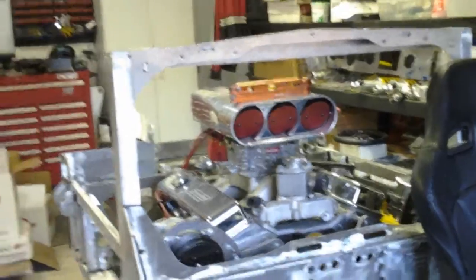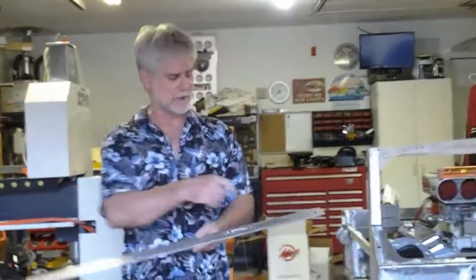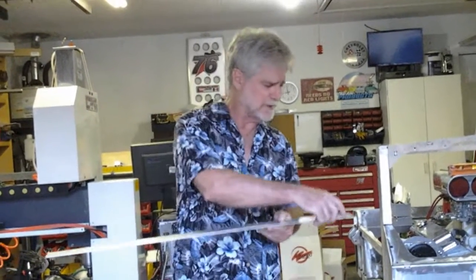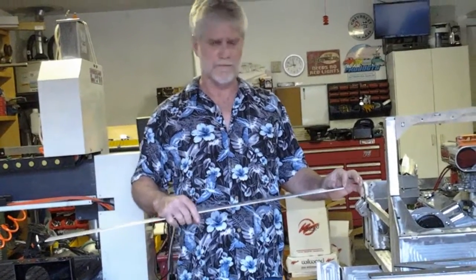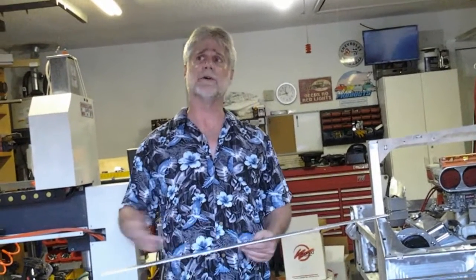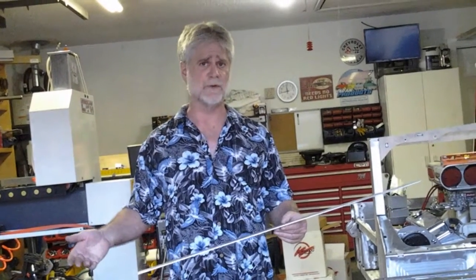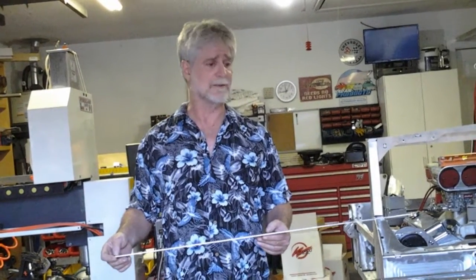Tolerance stack, just to give an example, for instance, if you take a yardstick and mark every inch, at the end of it, you're at 36 inches. But if you took it and you marked an inch, and you moved it and marked an inch, and moved it and marked an inch, if each movement is off 2/1000ths of an inch, which is less than a human hair, that's 36 times 2/1000ths, that's 72/1000ths, which is the same thing as 7/100ths, which is more than a 1/16th of an inch. Tolerance stack can add up in a hurry even when you're just adding up human hairs.